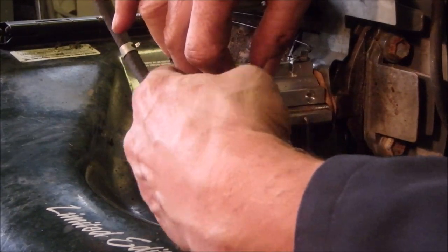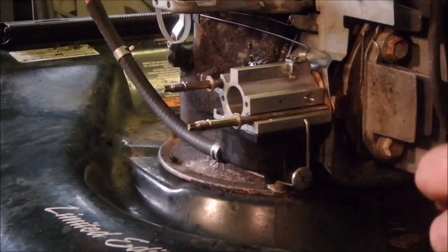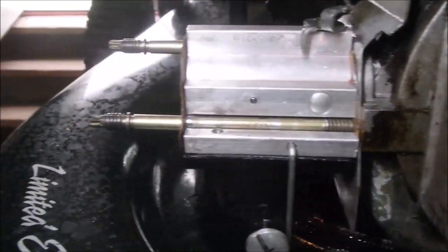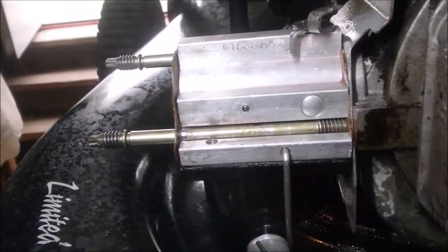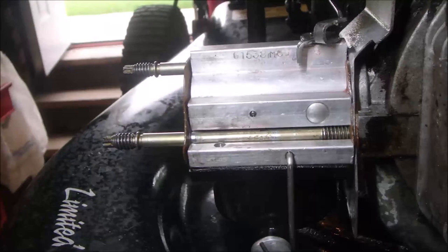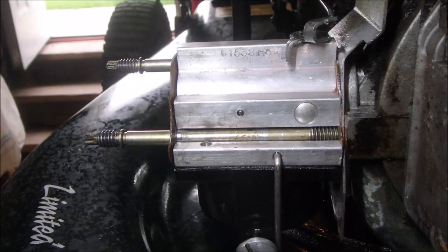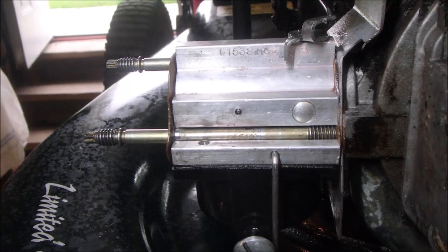One, two, three. Look at that. I've shown you this hole before, and I've held my finger over the hole, but I went online and looked up this model because of Ken from Ken Small Engines, and I found the model of this carburetor. So anyway, I ran into my two-stroke stuff and I put a Welch plug over that hole. I haven't hammered it in yet. But now we are running steady with no surging at 3150 RPM.